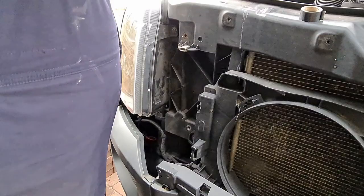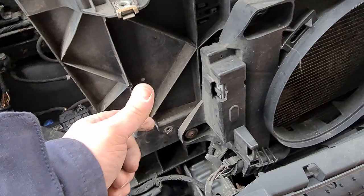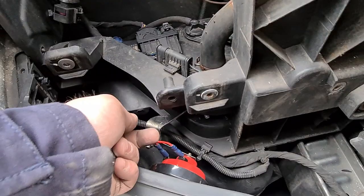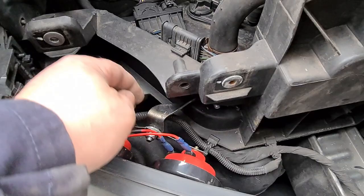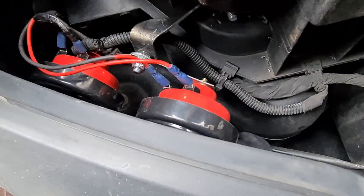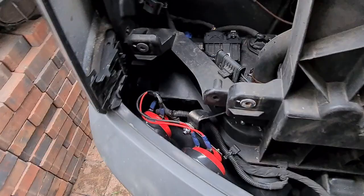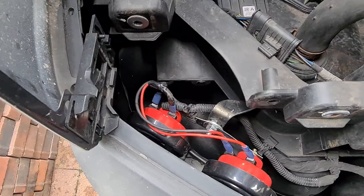So this is the new resting place for the horns. As you've seen, when we tried to install them in the original place they wouldn't fit — part of the rear of the grill made contact with them. So we just pulled the cable back off its two mounting points and we've stuck them back on down here. We used the original bracket, bolted it on, twisted it, and just popped them in there nicely. Now if I change my mind and I want fog lights in there I'm knackered — if I do put fog lights in there they'll be LEDs that bolt on the outside. Anyway, that's a good job done. Now we've got to go and get all those bolts and nuts from underneath that dropped down into this cavity — just pull on a couple of pins and that'll do it.